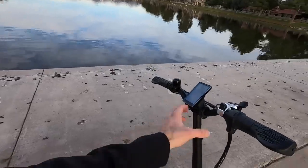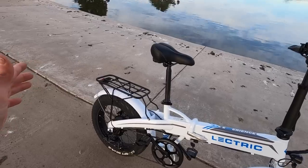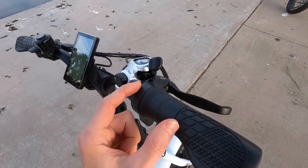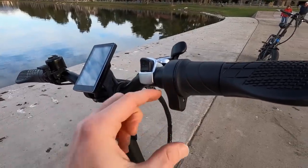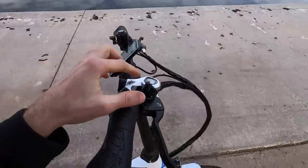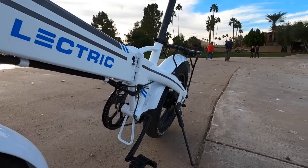Areas you could upgrade: wider or swept-back handlebars depending on your body position — the reach isn't too bad but could be improved. This is a very capable bike — more impressive than I expected coming in. One gripe: the big Shimano thumb shifter. With a twist throttle there's a wire protruding that would collide with trigger shifters, so the big thumb shifter is the solution. Frankly, for cold-weather riding or less refined hand motions, having a large clear shifter with a gear indicator window is totally acceptable.